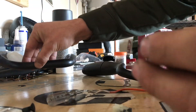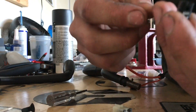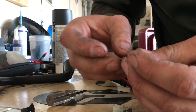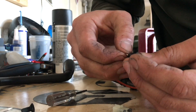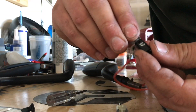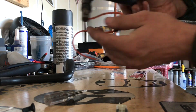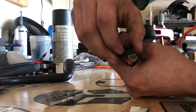Set the NBS one aside. Since you depressed the last tab, maybe bend them back out. These don't matter which one goes where - it just gives a temporary ground to the computer, so it doesn't matter which side goes where. Push the new ones in and snap into place. Get your little retainer piece - it just holds the wires in extra secure. Perfect - you don't have to cut and splice anything. These shafts are the same size and the flat spot is on the same side as well, so you'll just put it in and put the screw back in.